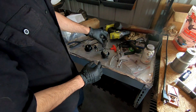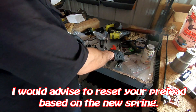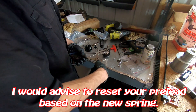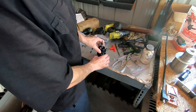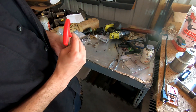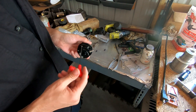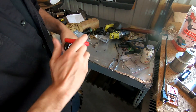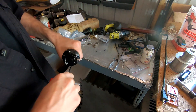Yellow spring coming out, black spring going in. I did notice this rod moves — I think maybe I should tighten up on it a little bit. I would imagine your preload changes if this rod moves. In case you're wondering, it is a four millimeter bolt that came out. So if you end up having one fall out like me, just go right to the metric aisle and look for four millimeter Allen. I did not put Loctite on here simply because there's a chance I have to take this spring back out — I didn't want to make these things permanent until I knew this was the right spring.